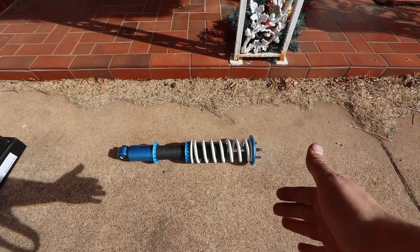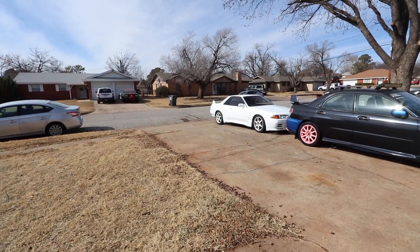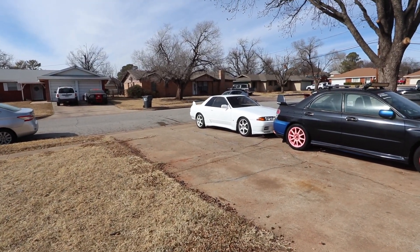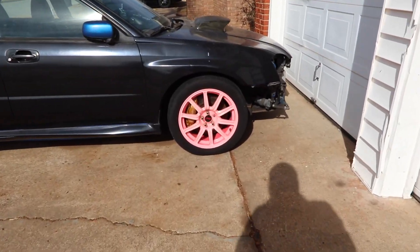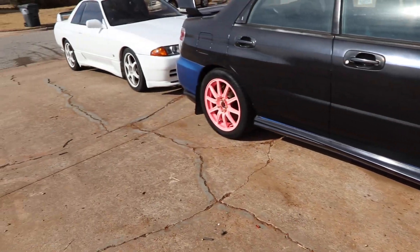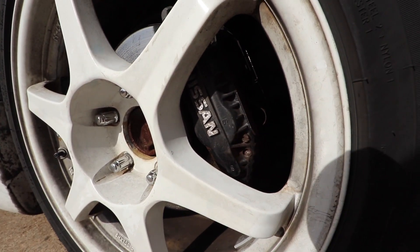I also thought about installing the coilovers today, but I haven't finished the fronts. So what I might do is just display that in the wheel well, right next to the factory one, just to see what the color looks like and the contrast. I also have caliper paint which I need to go get inside. As you can tell, I'm a big fan of the color pink, and that's also a theme I have for the Skyline. So we will in fact be painting the calipers pink — I just have to clean the caliper, scuff it a little bit, and try to keep the Nissan logo silver.